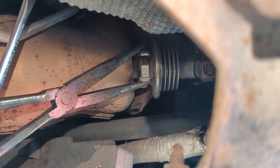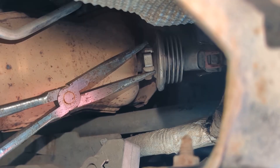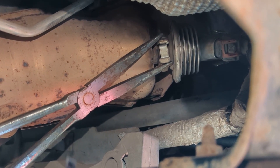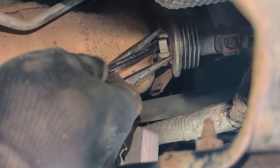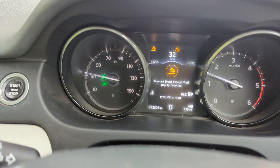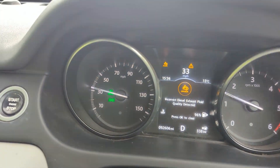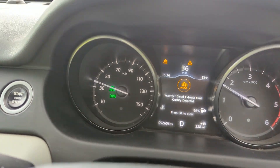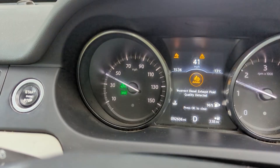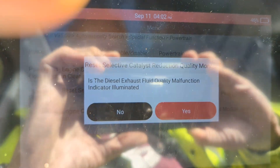So after we got the clip back on, we took the car out for a run hoping that the DEF quality message would disappear on its own. We drove for about 12 miles, ran the car, and the warning light was still on — the warning message still coming on: poor quality DEF fluid detected. We drove around and the light hadn't extinguished. We thought it would sort itself out. Apparently you can just let it tick over after the clean and it might reset itself. We don't think it will — it's not characteristic of Range Rover. Anyway, I'm going to cut to actually using the analyser to try and sort this problem.